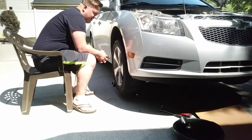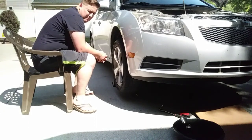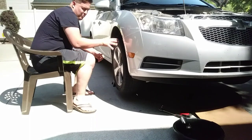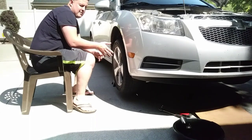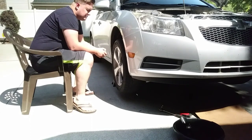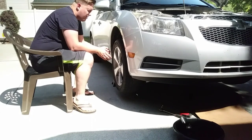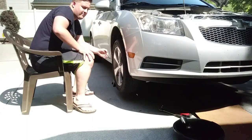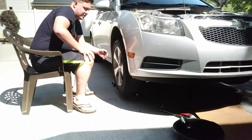Also, if it's a bad wheel bearing you might also be replacing brake rotors and pads, because it's not going to wear evenly. During a bad wheel bearing it's going to be flopping around due to steering, driving, and bumps, and it's going to unevenly wear out the rotor and pads. So you'll definitely want to look into that when replacing the wheel bearing.